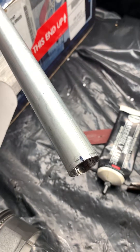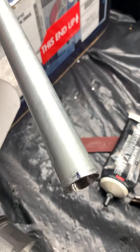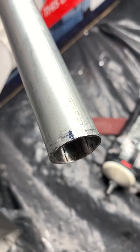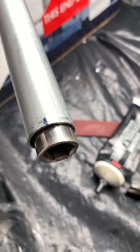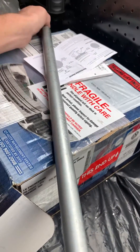This is my homemade version of the Porsche special tool for inserting circlips into the pistons. You can see my little index mark right there — when I have the circlip in, I know where the open end is. I basically polished up the inside, deburred it a little bit, same with where I cut. I've got a 14 millimeter socket on the end of a 24 inch extension.